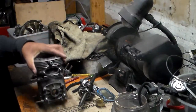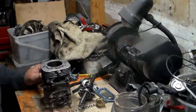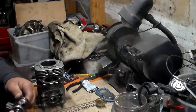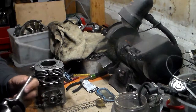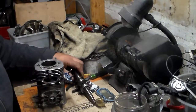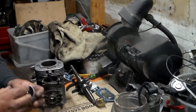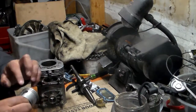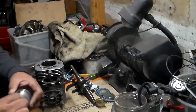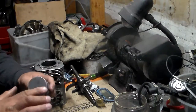Continuing on my Toro snowblower S620 - I have one head done, I made all the gaskets for it, and I cleaned up the main part as best I could. I cleaned up the crankshaft. This crankshaft is in very good shape - there's no scores or anything like that, still looks really good. The piston and the rod look in very good shape too. The piston has very little scoring, just a little bit right here, but I don't think that really matters. The rings are still free in here, so it looks really good. I cleaned up all the sides, the top and everything - it had a lot of carbon on the top, but that was okay.